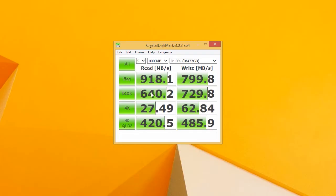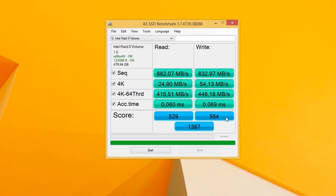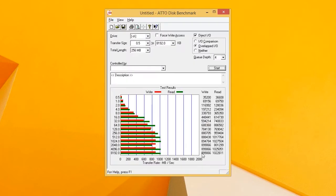The performance figures are really staggering, almost doubling in comparison to a single Plextor M6S drive setup. In theory it should be like that with a RAID 0 array, but it usually isn't, and in the best case scenario you can get pretty close to that — almost like we did here. Within the ATTO benchmark, we almost reached 1GB per second of read speeds, just shy of a few megabytes. All in all, we got very good RAID 0 scaling performance from the Plextor M6S.